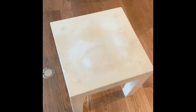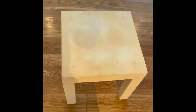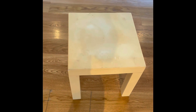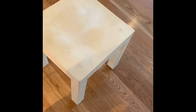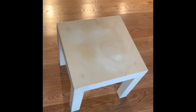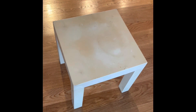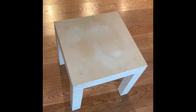Here we have a Parsons table which is yellowed with age. The yellowing is typically caused by the fire retardant used in the plastic, which somehow reacts with light and forms this yellowy-brown color. This table, at this point, looks like it should be thrown away. Let me bring you through the retro-brighting process and see how we can bring this table back to life.